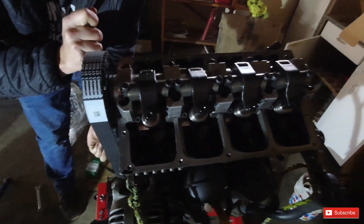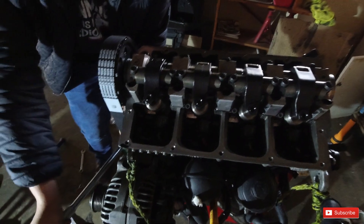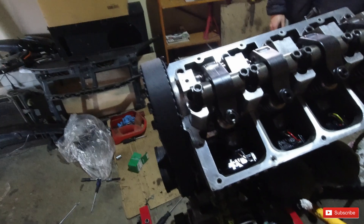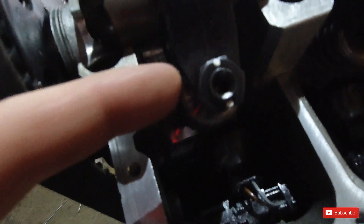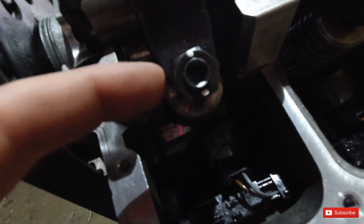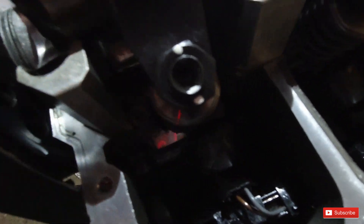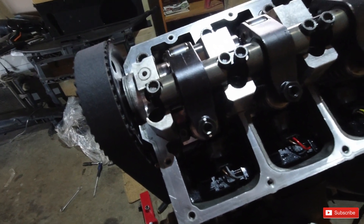We'll be doing that with each one of these. I've done injector number one now - I had to do a test injector just to see the procedure. You can see it's marked off now. Basically you just turn the engine over till the injector spring is fully bottomed out, then you turn the center cap all the way till it doesn't turn anymore, make your markings, and turn it 180 degrees back.